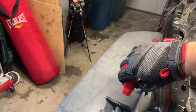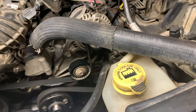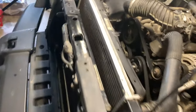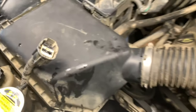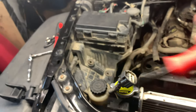Your best bet is to have this tool — if you own a Jeep, you should have this tool. I'm going to take off the overflow hose right here — it just unclamps. To get to the four bolts for the shroud: there's one up top, one at the bottom, and one right behind the intake. Two bolts there, two bolts there, so the intake is going to have to come off. There's also a shroud at the bottom, and you use this same tool to take that off.